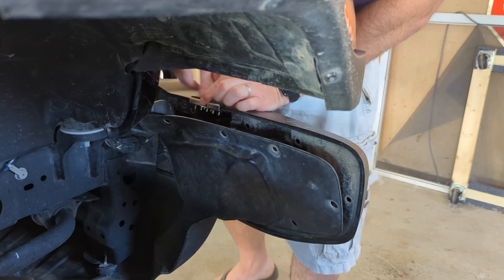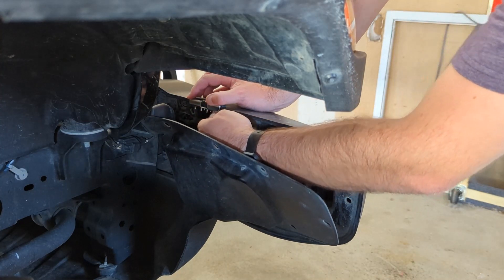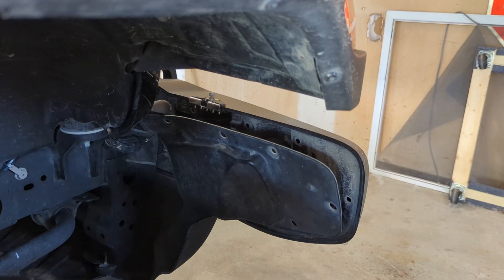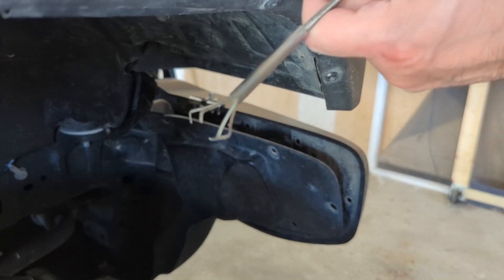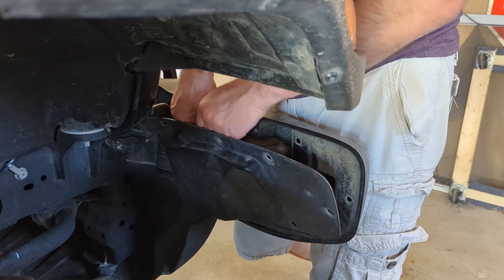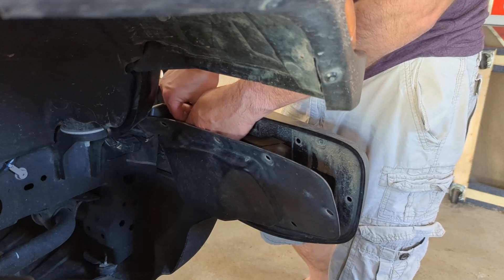It's easy enough, even though it's kind of awkward to get them started by hand. I kept dropping the wrench in there repeatedly, that's why I went and got my grandpa's grabbing tool - I can stick it down in there and get the wrench back out. You have to keep going back and re-tightening the ones you did before: tighten one, gives the others more room to get a little tighter. And this bumper cover is plastic, so it's pretty squishy - get it nice and tight.